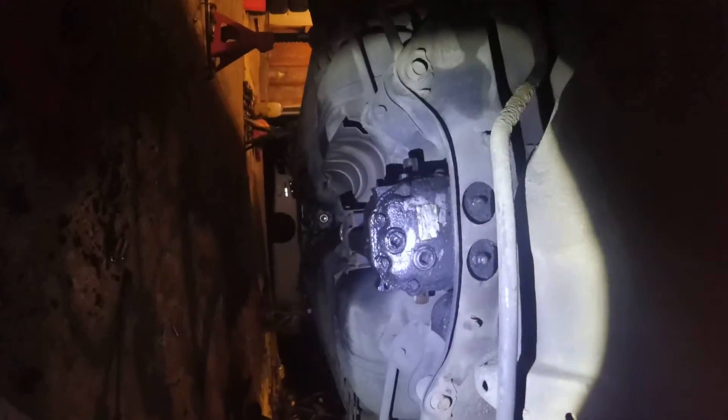I broke these free — there are two 17mm bolts, so just take those out. There are also some more right here, also 17s — there's four of them — and then we can just drop the diff out. Now there are four more on the outside right here holding this bracket on. I'm gonna take the back two off first, then probably take this one off and leave the last one on, support it underneath, and pull it out.